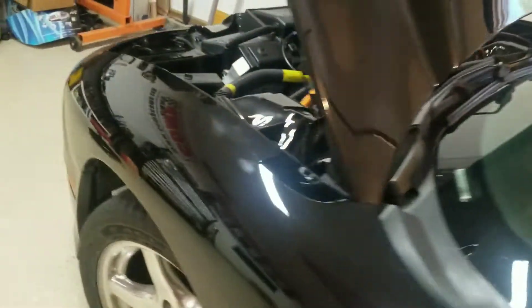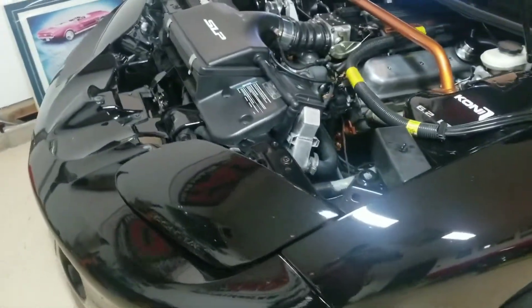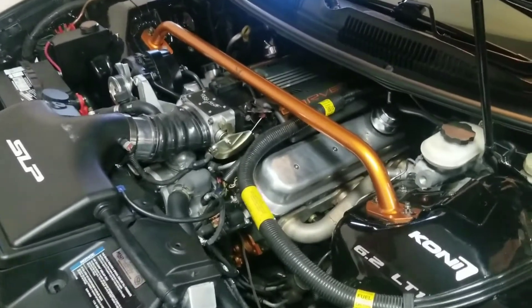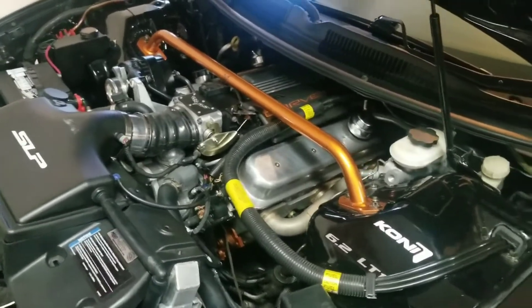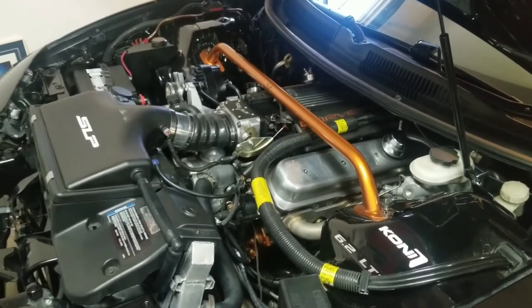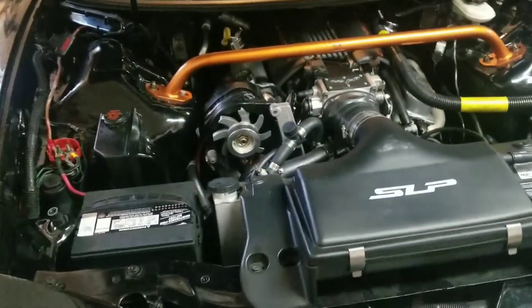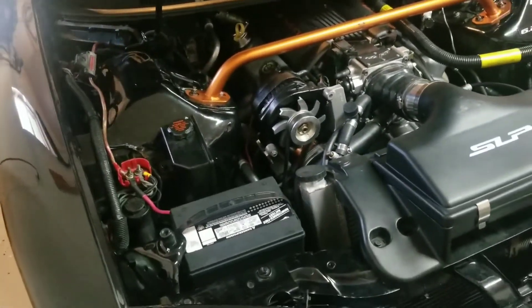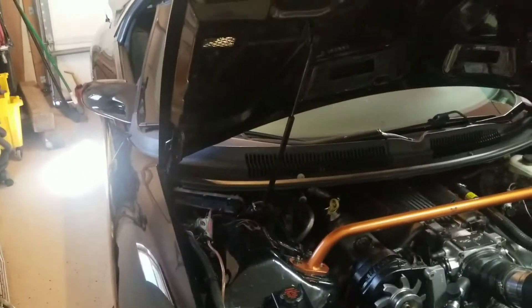Touch screen, full stereo, no back seat. All the inside's been Lizard Skin coated and sound deadened. This is a 383 LT1, it's got LE2 heads on it, LE2 intake fully ported, LE2 cam — custom grind cam. This motor's making right over 500 horse. It's got a little cutting out problem at high RPM, so gonna try some more things to get it figured out — that'll probably be on the channel.